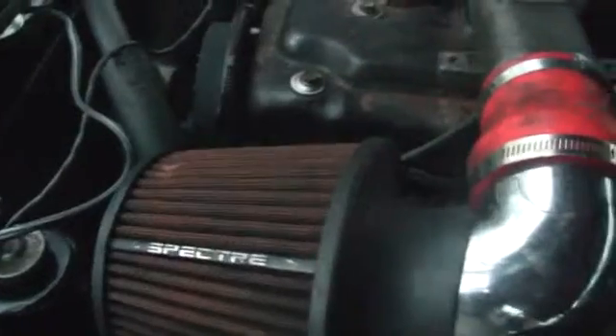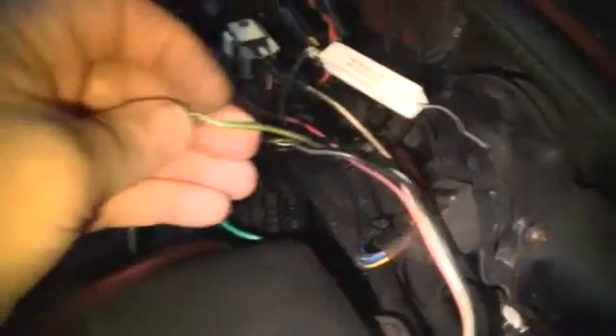Funny thing - without the resistor in series I shorted it out and the engine was turning. It actually bumped the motor - it almost had a good enough mixture in the cylinders to fire it off. So this box works. I hear the inductor like an inverter running. Just check the coil, the distributor wire. This thing draws like a half an amp so my transistor - my box isn't deep enough - I'm gonna have to use a FET. This should work but I was kind of half-ass making a spark, not very lively.